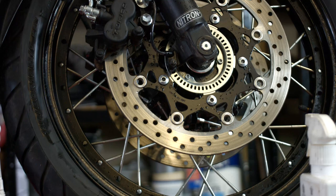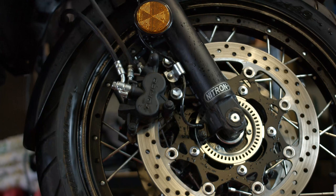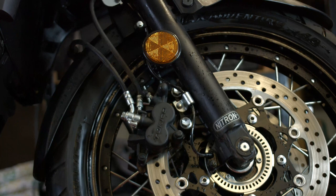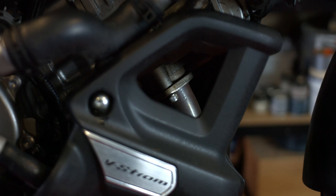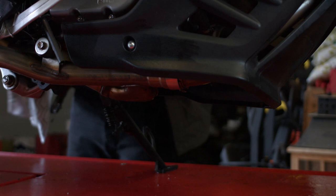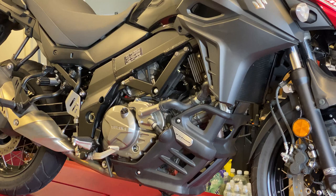Let's look at the finish areas I was most concerned about: exhaust rusting, paintwork, and spokes. Starting with the spokes — these are alloy rims with nickel-plated spokes; stainless steel would be better but that's a cost decision. They're holding up pretty well but you do have to keep on top of them and they'd benefit from a more intensive cleaning regime than I've been prepared to do. The exhaust has kept pretty well — I spray the bike with WD-40 between washes, which has done a reasonable job.